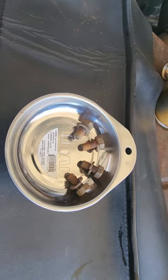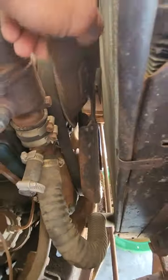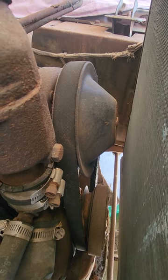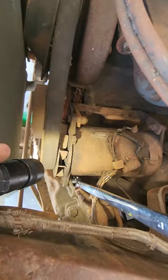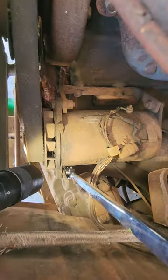There are a little pictures here and there but mostly it's typed up. I'll try to get a picture or two in there as well; if not you can go to the website. Now that we have the bolts off, just take the fan off and now you have the water pump exposed a little bit more. We're going to get to the belt and the bolts needed to remove it. We're using a 9/16ths on the generator — the alternator of the day. You'll want to change the belt out — that's a good recommendation — and there's your first bolt.